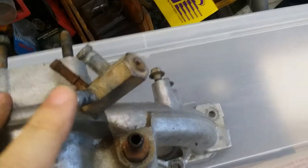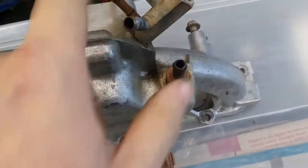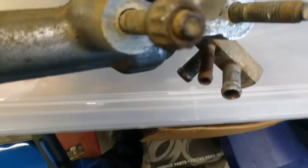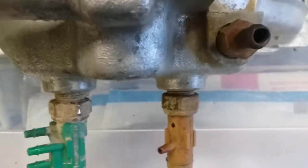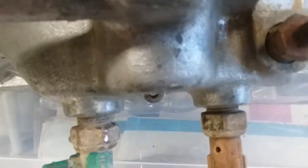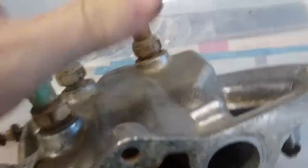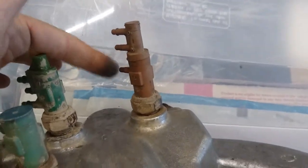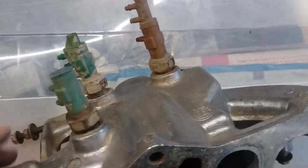You also have to detach whatever hoses you have going into this. I think most of these are cooling lines. This one would be PCV because it goes directly to the intake. This one is your coolant line, because this whole bottom chamber — everything you see in the frame — is all coolant. Coolant goes into the center chamber and heats up all of these vacuum valves. Once these vacuum valves open, you now have vacuum going from these two plugs to this plug, this plug to these, and this to this, to do various things.